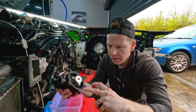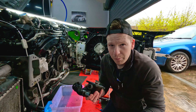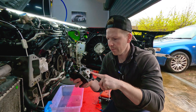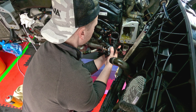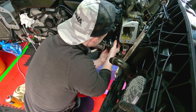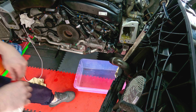Let's get this on the car. Same process as before - we're going to slot that pipe on in reverse order first, then line that up, and then we've got these five T30 Torx screws that will go just around the outside. I am going to put just a tiny bit of silicon grease on there to help slide that into that pipe a little bit easier, and just rub a little bit around that O-ring seal. Hopefully it'll help.